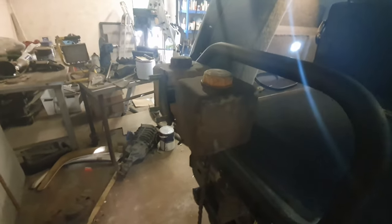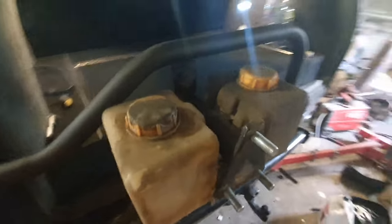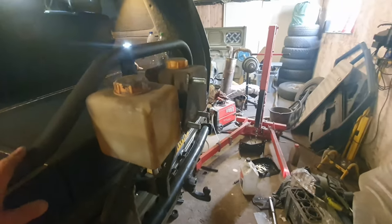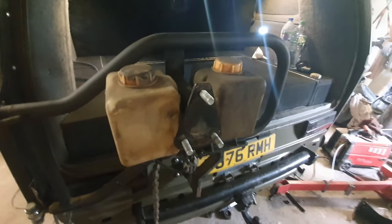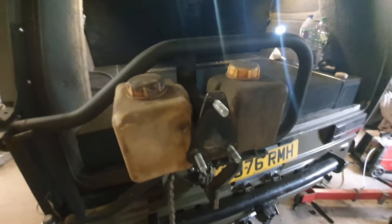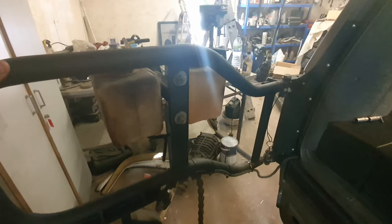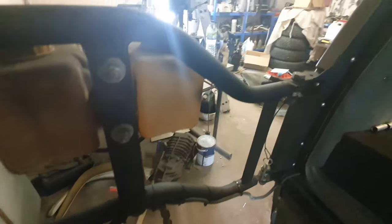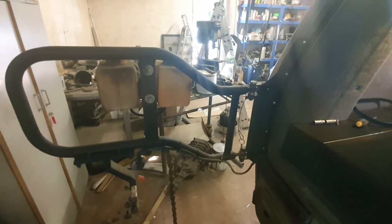Also, the van is obviously a petrol engine with the EJ25. For the diesel tanks for the heater, instead of having them inside the car — because no matter how careful you are you'll always get spillage — they're out here on the spare wheel carrier. Once you've got a spare wheel mounted on there, the tanks sit nicely inside it out of the way. The feed cable then goes down through the chassis rail towards the diesel heater — it actually worked out pretty well.